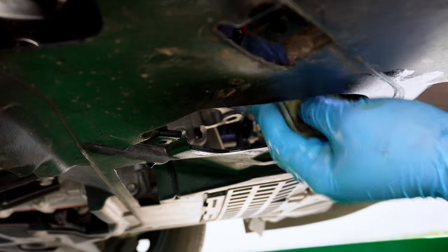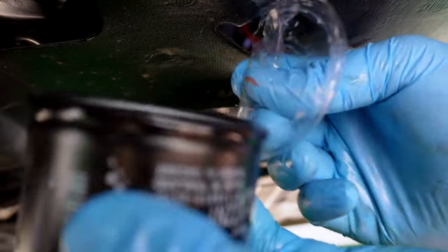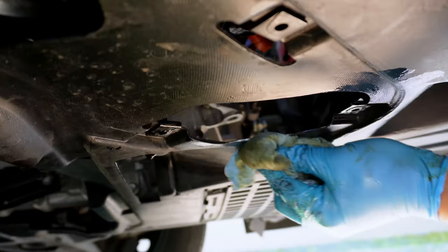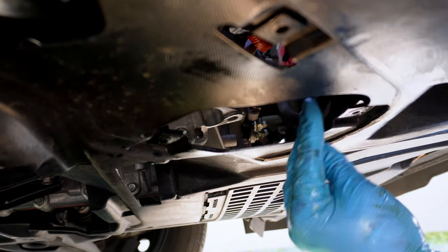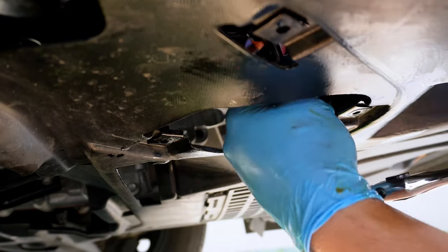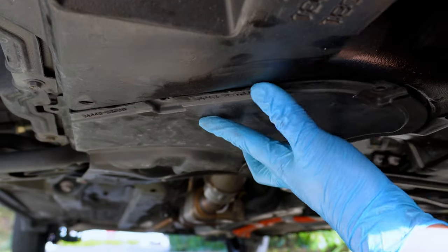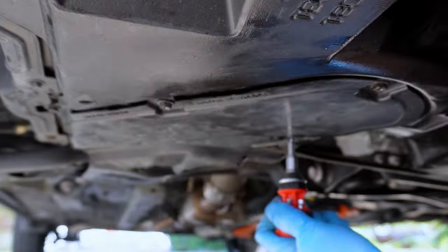Now we can clean up all the oil that dripped on the panel. For the new filter, I'm using a Toyota OEM one and the part number is in the description. We'll take some oil — doesn't matter if it's new or old — and generously apply it to the gasket to help it seal. Unlike the aftermarket filter, this OEM filter does fit the 65 to 67 millimeter 14-flute cap wrench. For now, I'm going to just tighten it down by hand. You'll also see me replacing one of those metal clips that fell out when I removed the panel — make sure you see one for each screw hole, as that is what the screws fasten into. I then used a cap wrench to confirm that the filter was snug, barely turning it as I didn't want to over-tighten it. Now we can put the panel back on, making sure the screw holes are lined up with the clips. We'll check that the panel is secure and we're good to go.